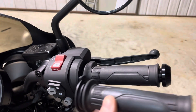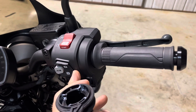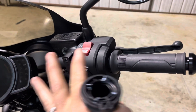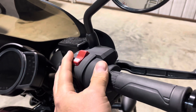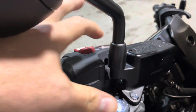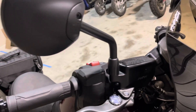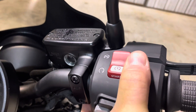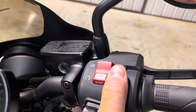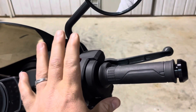Then you're going to slide that assembly back in there. Since you only took out the small silver screw, put that screw back in and give it a nice snug tightness — no Loctite involved. Put that to the side, then get the assembly sandwich back on and loosely tighten all three screws. Once they're uniformly snug, go ahead and work a good hand-tight on all of those. Note that this assembly does pivot just a smidgen — that took me a good 30 minutes to figure out, but it's completely normal.